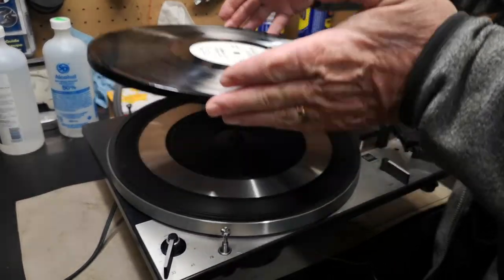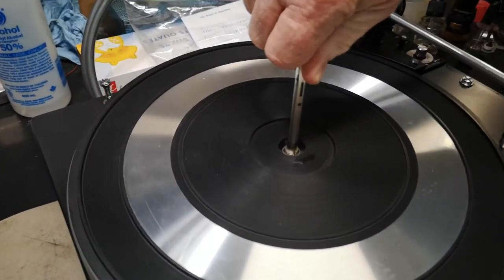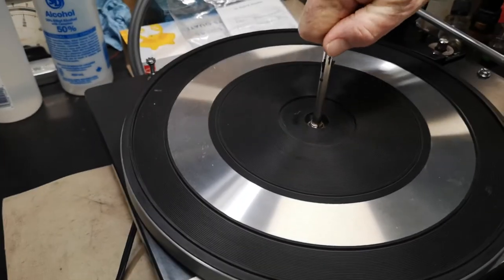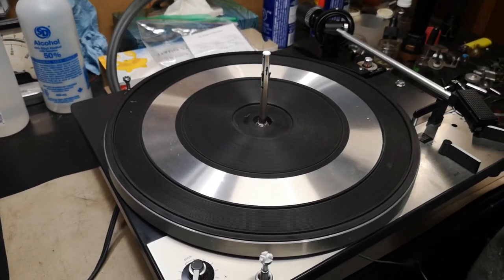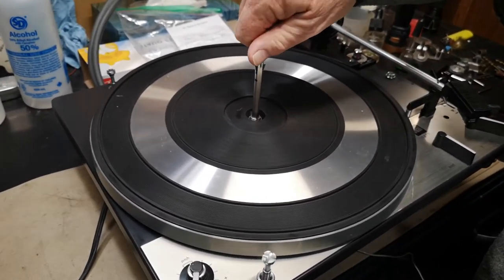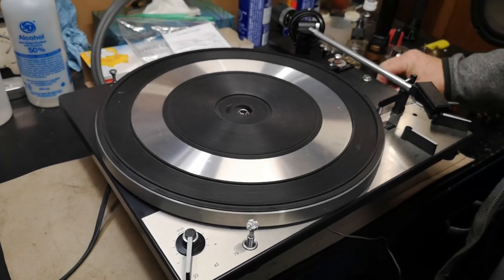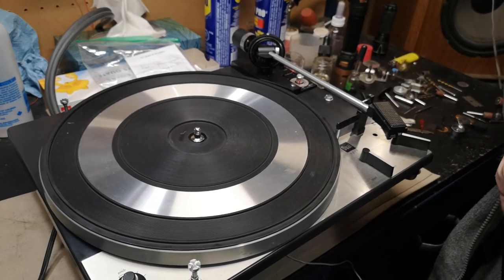To remove the spindle, pull all five albums off, then push down, turn counterclockwise, and pull it back up again. Never try to pull it up when it's locked in position — that may be what happened last time, pulling the whole shaft up. The shaft is in there pretty good now, very well sealed, so it won't pop out again unless you force it. Make sure you turn it counterclockwise till it springs back up, pull it out nice and easy, then put your 33 spindle back on and switch back to single play if you're doing single play. Okay, that's it — thanks!